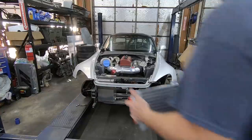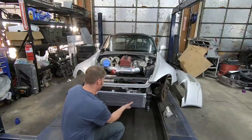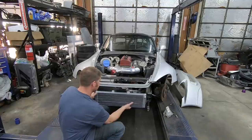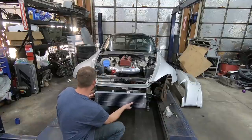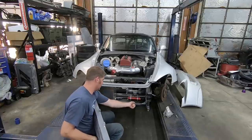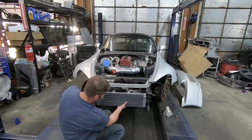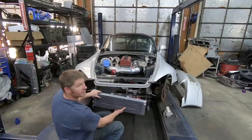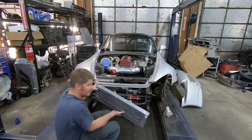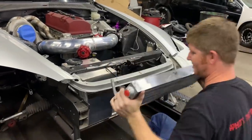All right, front bumper's off. We're going to mount right out here, just a little further out than the end cap, so the frame rails are here. That means fitting stuff has to come off again to make it easier to plumb. I'm just going to build a couple stubs that come off a couple bolts - should go right through it and hold it right there. Then we'll build the upper mount, get the radiator mounted, and figure out plumbing for the sides.